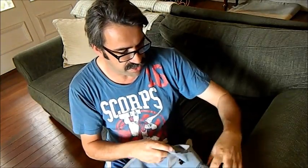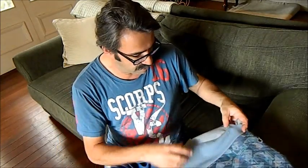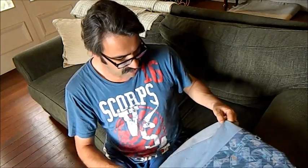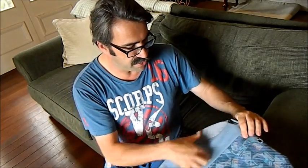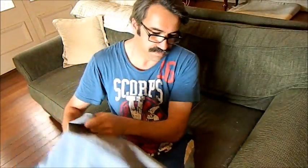Now this is just a demonstration, so I'm just going to hand stitch this. The best way to do this is to take it to a motor trimmer. Any material they put on is going to look different, so the best thing to do is to go to a wrecker and get a back seat. Back seat's much cheaper and easier to find than front seats, and cut out the bit of material you need for that panel. Normally they unpick all along these stitch lines, and then use that as a template to make a new one and stitch it in. Of course you can't see the difference. So I'm just going to hand stitch this, and we'll see how that turns out.